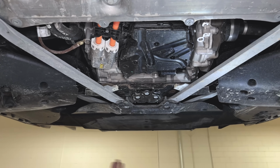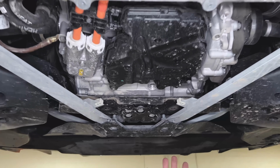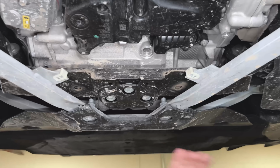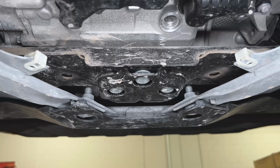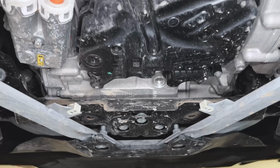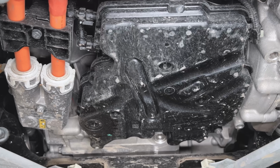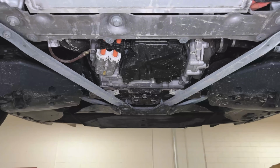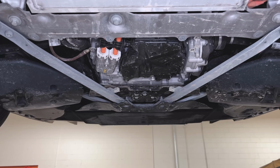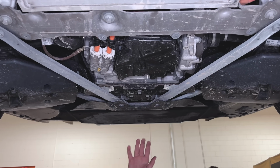So I think that's probably being driven by the diameter or the size of this gearbox and the electric motor. A conventional diff and a prop shaft is not going to be as tall in the Z-axis, or vertically, as this is. So this is going to drive all those structural monuments that do need to be there from a dynamics perspective lower in the vehicle, because obviously they can't float through the casting and so forth.